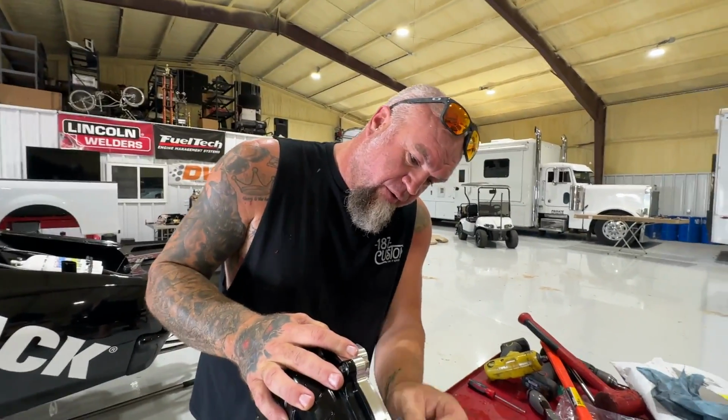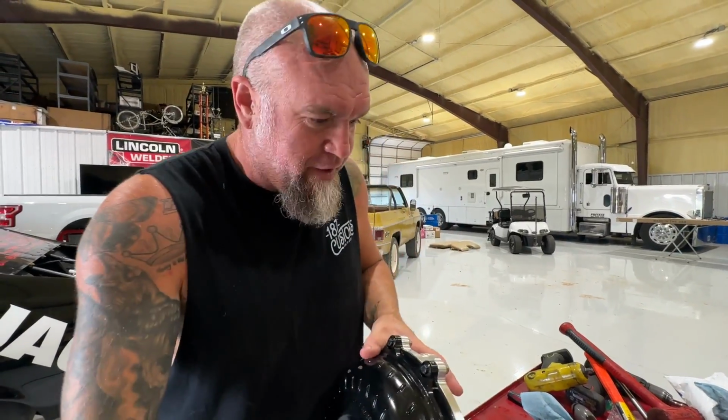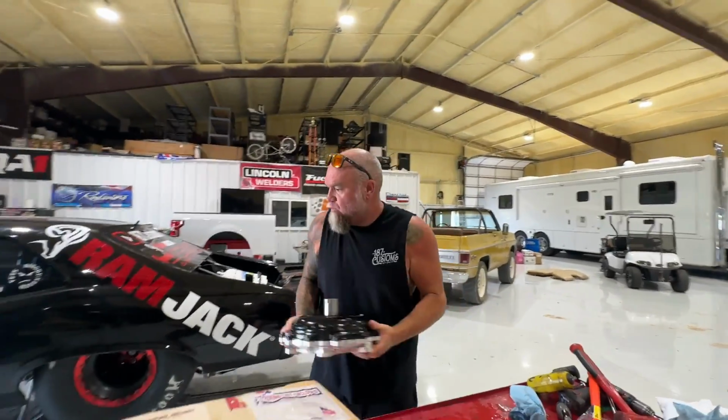See how there's no feet on this one? When we get home from testing, we will pull this thing apart and we'll video the whole thing of us doing it. And honestly, I see guys do this by themselves all the time. This is a two-man job, in my opinion. That definitely makes it easier. Sliding the piston in up top and having somebody underneath who can turn the crank so you don't have to, and then once you get the rings into the cylinder wall, you can push it in. But man, it's so much better if you've got somebody. Yep. Here we go.